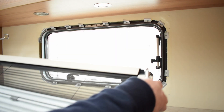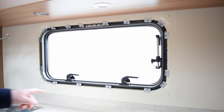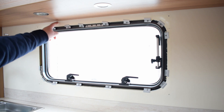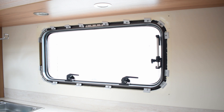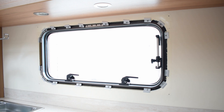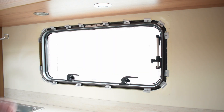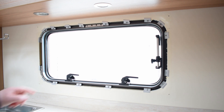So that's the blind loose — we'll take that off and put it to one side, just keeping the screws safe so we don't lose them. The window is just stuck in with clips all the way around the edge that push or pull the window in. You can also see the foam and the Alu-tex sides there, and we can check whether it's dry — which is absolutely bone dry, which is good.